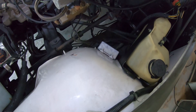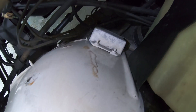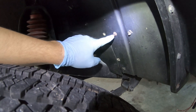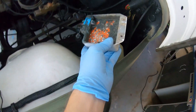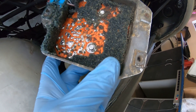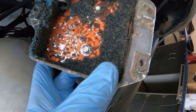We got the coolant recovery bottle out — that was just three 3/8 bolts of varying lengths. That should be the ignition control module down there, and it looks like that's got a couple of screws that come in from perhaps the wheel well. Looks like this one's broken off and we just got this one to deal with. We got the ignition control module out — as you can see that screw was broken off. That was another 3/8 bolt holding it on there. You can see all the potting on the back of the module is just completely gone. Hopefully it's still good — I guess we'll find out.